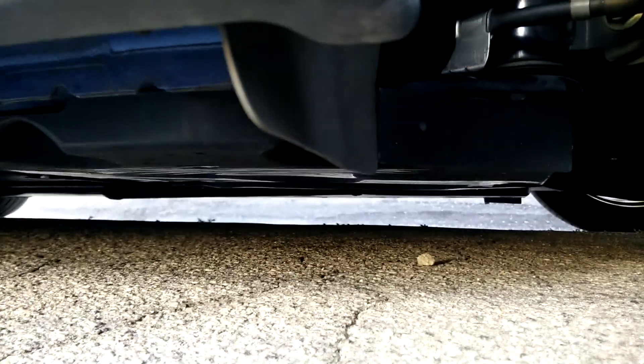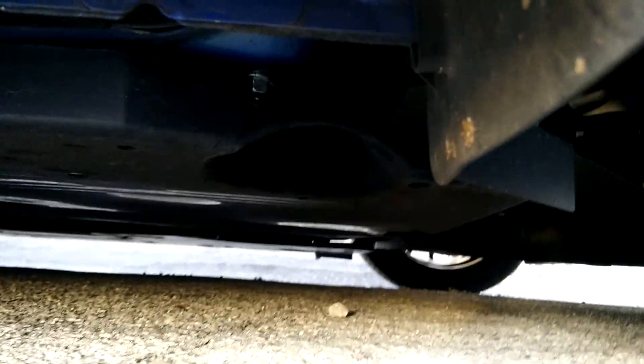The front under panels fit wonderfully into the JDM under panels. My car is a 2015 Series Blue, so it does have the full JDM underbody panels. All you have to do is trim it very slightly — there's a horizontal line that runs parallel to the bottom of the JDM under panel, and on the inside there's another line where the panel comes up. You only have to make a straight cut and it literally looks stock. I was shocked with how well this fit together with the JDM under panels, especially considering Velox was very specific about it not being designed to work with them — but I think it was, and I think it does.